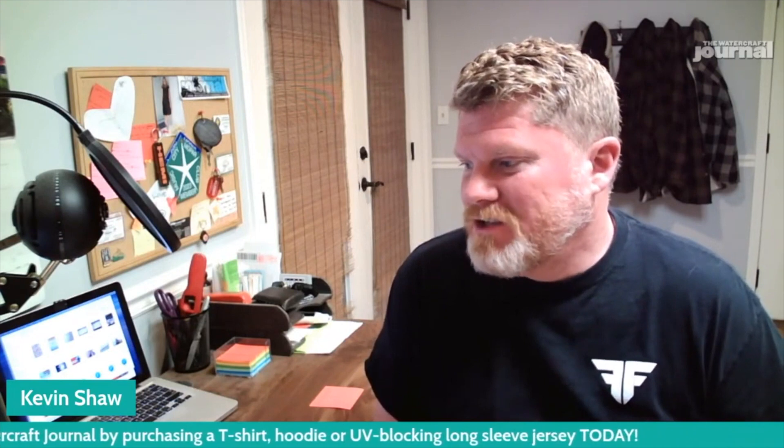Cleave writes: I just purchased a 2023 FX SVHO Limited a month ago, never been in the water. I see that the hull is scratched where the carpeted bunk slides. Should I return to the dealer? The paint is soft — you can buff out those scratches because they're just friction scratches. It's not easy, but you can buff it out with a buffing wheel and some buffing compound. If they're gouges you've got a problem, but I think they're very light scratches.